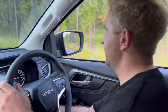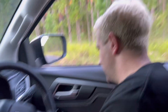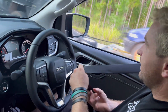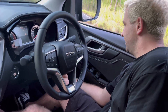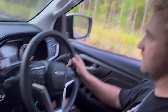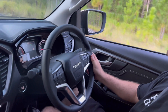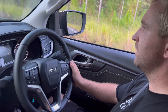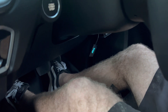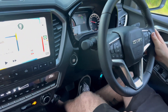So if you flick that now to crawl mode — pull over somewhere and flick it to crawl. I'll turn it to crawl one. The further you turn it down the better. Crawl one will be as slow as you can go, so then if you sort of accelerate hard — that's foot on the floor there — it has a big delay. So when you're out rock climbing or at a boat ramp or whatever, it really delays it — 80%. But then on your dash here it says it's a 20% throttle input, then it'll pick up.